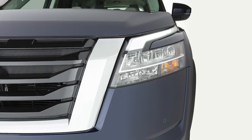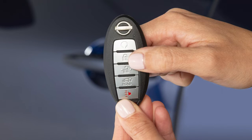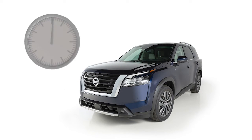The engine will run for 10 minutes and then turn off. To extend the time for one additional 10-minute period, press the lock button on the key fob, then press and hold the engine start button for at least 2 seconds. Runtime will be calculated as follows: the first 10-minute runtime will start when the remote start function is performed. The 10-minute extension will start immediately after the remote start function is performed a second time. For example, if the engine has been running for 5 minutes and you extend the remote engine start, the engine will run for a total of 15 minutes.